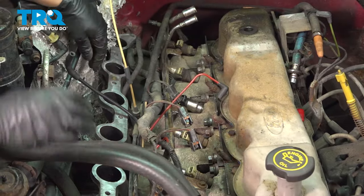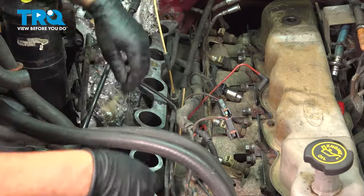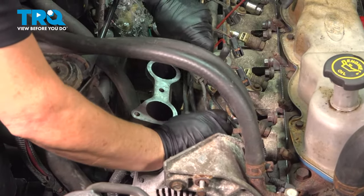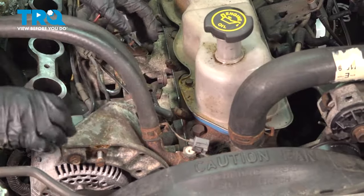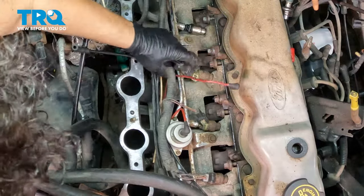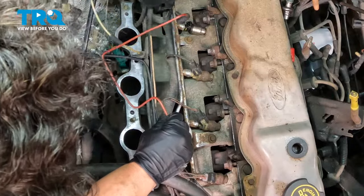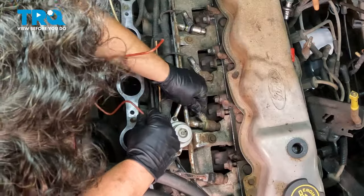Fish the O2 sensor down and reconnect it — green on green to your click. There's one more over here. Make sure everything gets out of the way. Get your vacuum lines in place — as you can see, several broke because they're pretty brittle; that's very common. The cool temp sensor is identified here. Now locate each injector harness and snap it back into place. Disconnect the regulator because the vacuum line is going to be in the way. Don't be afraid to twist and turn the injectors to line up the harnesses. Lay them all down so they don't get in the way.